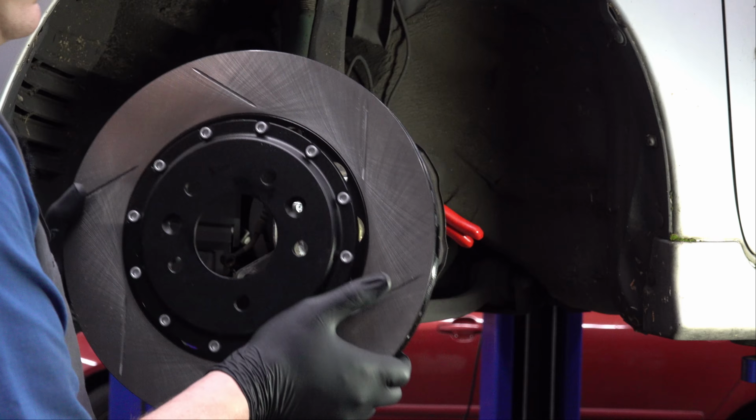There's less friction. These are internally lubricated by the brake fluid, so they slide easier. It's just a better design. The other thing that I can't really show on camera is that this, despite being substantially larger, is also substantially lighter than that, because that's aluminum, that's iron.